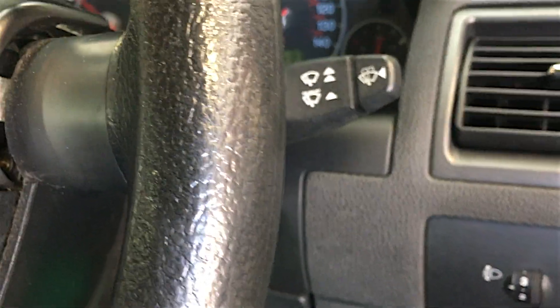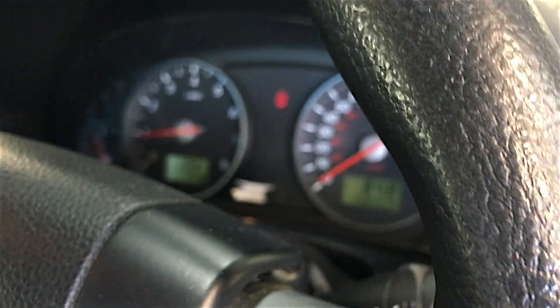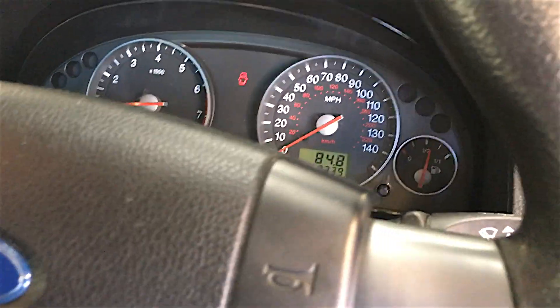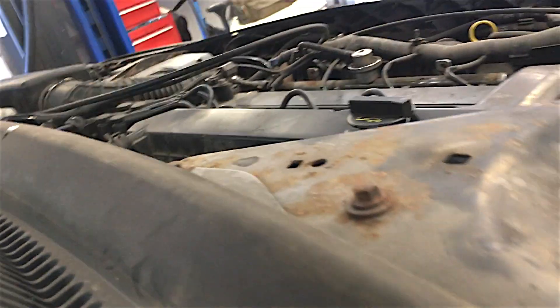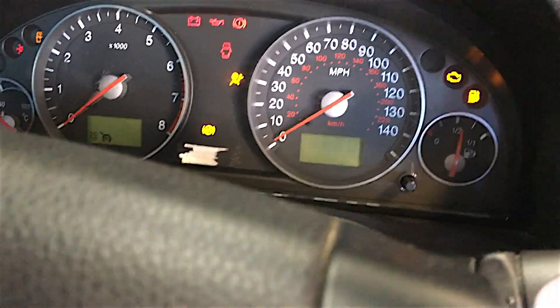You can see it runs if I touch the throttle. It's actually revving a bit now, but it wasn't even revving before. The warmer it gets, the more you can't rev it. It smells really terrible. I'm flat out on the throttle and it's just cut out. Literally cut out. When it's cold it will start and rev a little bit, but as soon as it warms up a touch, it dies.